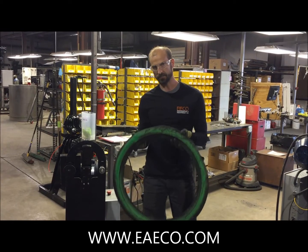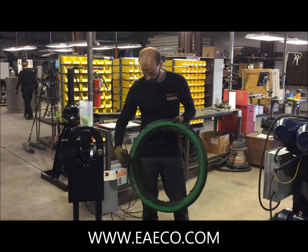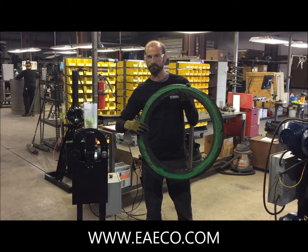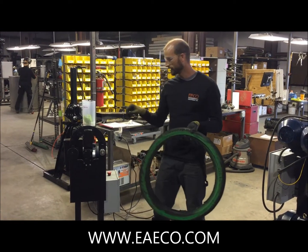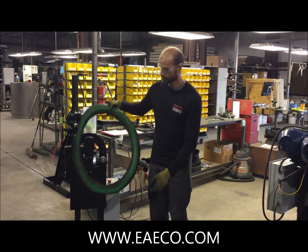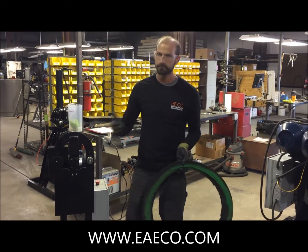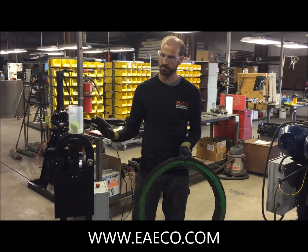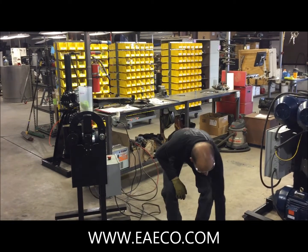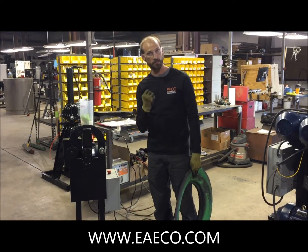Here we have a sidewall that is a Pirelli P0 model. Even though you can't tell there is steel in this sidewall, there are very fine fibers of steel in it, and this machine will detect it immediately. You will become familiar with these types of sidewalls. We recommend finding a way to just not process them into the chipper at all — don't even try it. The machine has stopped, and that's what indicates to you that it has detected metal.